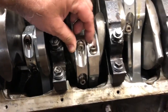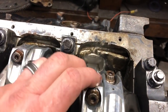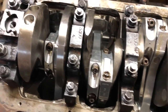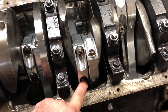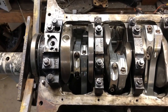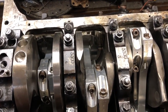Once they're all on, I'm checking the side-to-side clearance, making sure nothing is binding and all the clearances are good. Also checking down where the rod meets the piston to make sure you've got good clearance there — you don't want it too tight. I torqued the rod bolts in two steps: 45 foot-pounds first, then 45, then 75, then 75. GRPs just recommend using 30-weight motor oil for their torque process, so that's what I used. Everything went together smoothly.